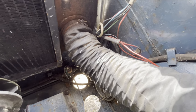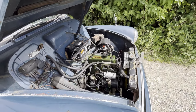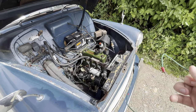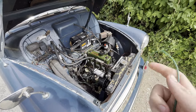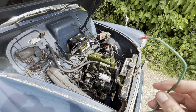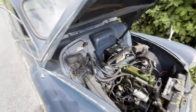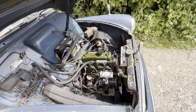This is live diagnostics — I haven't checked this yet. For quite a basic diagnostic, we just need a piece of wire. It's literally a couple of crimp connectors on the end of a bit of cable — I just had this lying about at home. Having wire with crimp connectors is quite useful for this kind of thing. It's unlikely that both bulbs are gone, so the easiest place to start is the switch, because the wires just pop off the top.